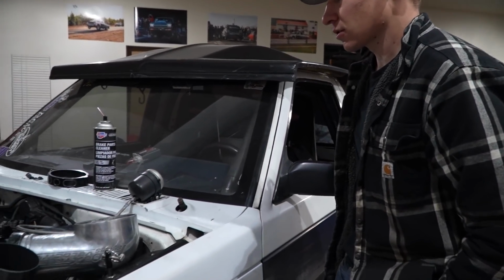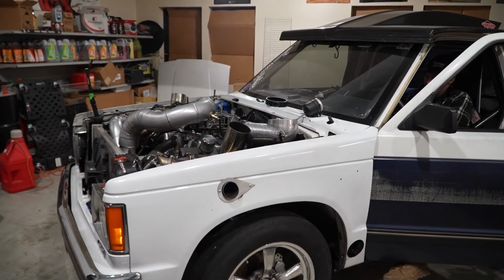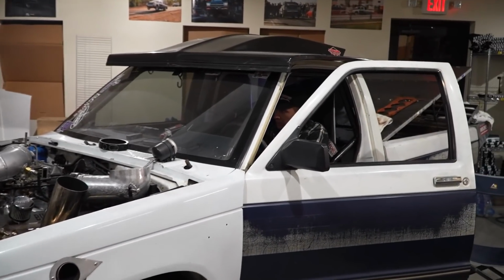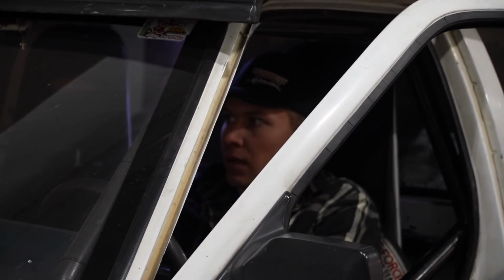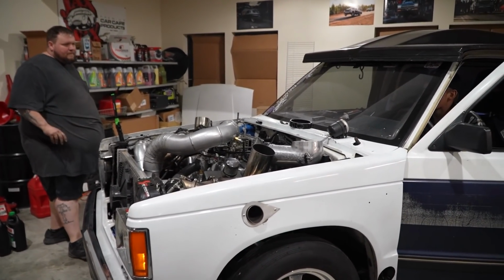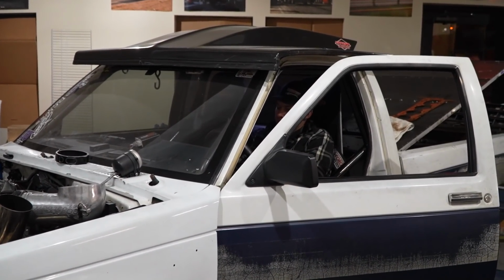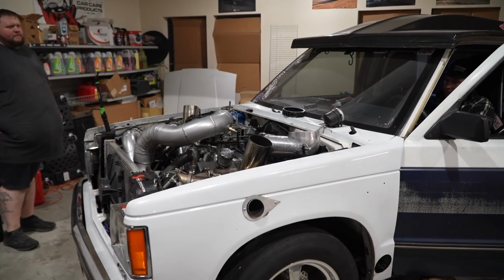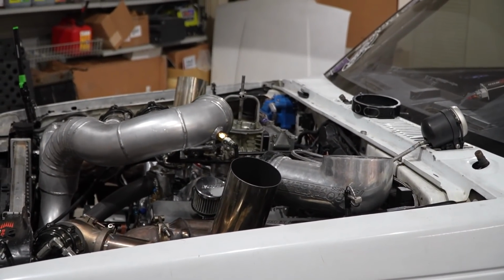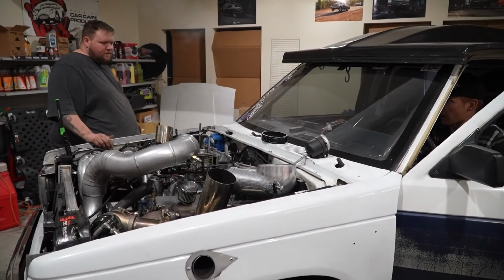Dumb. And you just wire the switch in. Coil plugged in? Yep. So you don't have anything up here. God damn. There's no fuel coming out when you're pumping. Like a plug wire is on wrong, or the distributor's turned somehow.